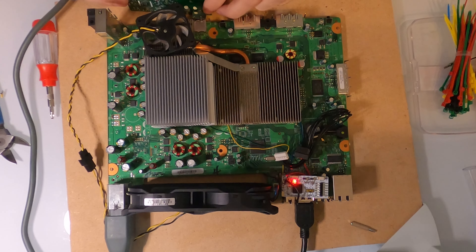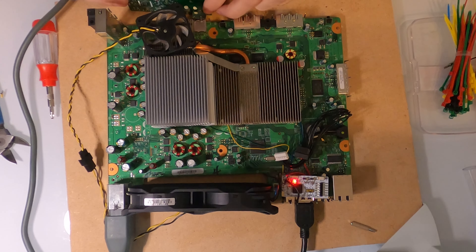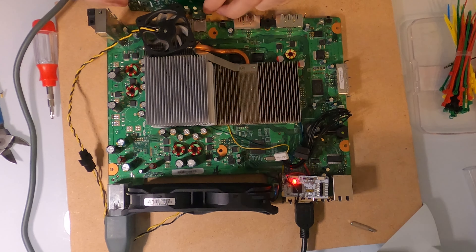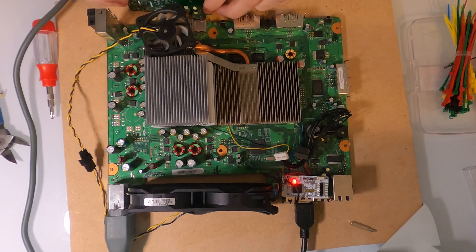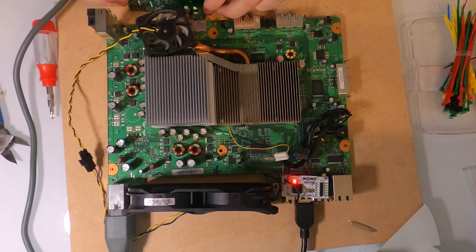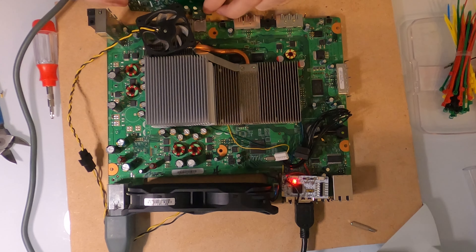There you have it — the fan is installed, wires are in, and I'll go ahead and plug this in. I've increased the airflow inside the Xbox 360, and hopefully that should keep the system quite a bit cooler. Tonight I'm going to play Resident Evil 6 from the hard drive and see how the temperatures hold. One of the best things about having an RGH Xbox 360 is that I can install a game disc on the hard drive and play it without putting the disc in the drive. I'm using Aurora as the loader, and if I press the home key it will tell me the current temperature. Right now I'm running at 45.9°C on the processor and 49.3°C on the graphics.